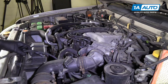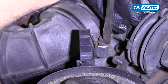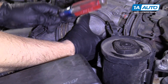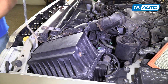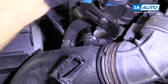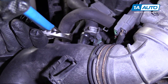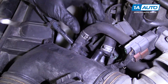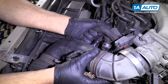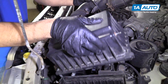Just push it out of the way. Next, we can use a straight blade screwdriver to loosen up the worm clamp on the throttle body. Loosen this one, pull that out of the way. I'm going to pull these hoses off using some channel lock pliers — just pinch the clamp and then twist it back and forth. I'm going to do the same for this one. You can pull this box out of the way.